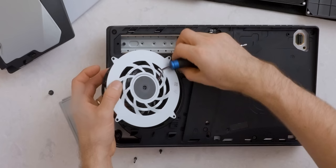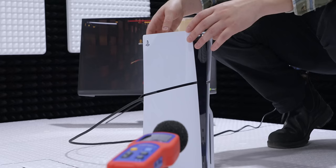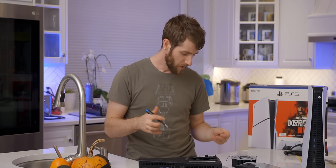Let's get this fan pulled out. As interesting as it looks, what we really want to know is how loud it is. To find out, we threw this thing at the labs before we took it apart to get some measurements. We don't yet have an anechoic chamber, but we do have an EMC chamber — which is not anechoic, but is at least really quiet, somewhere in the 20 dB range. We don't actually know because the noise floor in here is lower than what our microphone can pick up. Seriously? All four of the screws for this fan are different? Three different lengths — two of which go into metal, two of which go into plastic. Unbelievable.